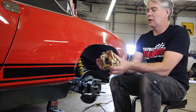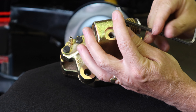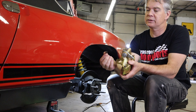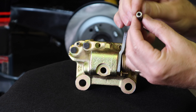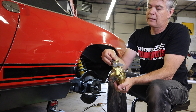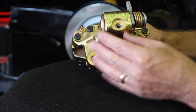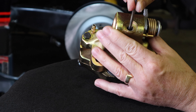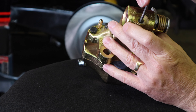When you're looking at the brake caliper, this side where the emergency brake hooks on is the inboard side, and there's this little geared shaft that goes in. It slides in here and those gears connect to gears inside, and as you adjust it with an allen tool it will move the piston in or out depending on how much clearance you need.